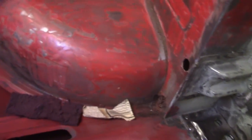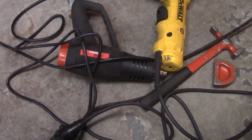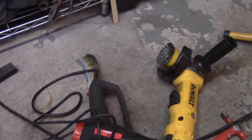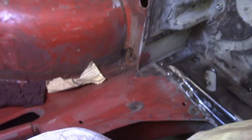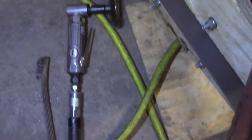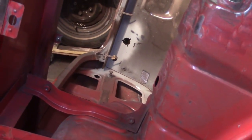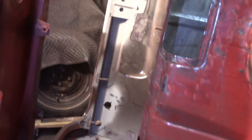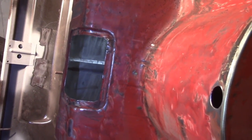I'm going around with either the Scotch-Brite or tools of the trade here — wire wheel, a heat gun to loosen up some of the seam sealer, a hand wire brush, various picks and scrapers and sandpapers — bringing everything to bear on this puppy to get her cleaned up. It's a mess. It's hot from this halogen light, but it's coming along. Dirty work, but somebody's got to do it.